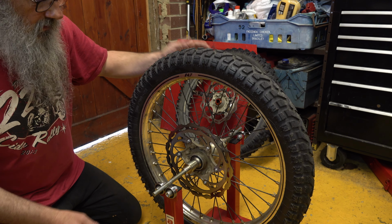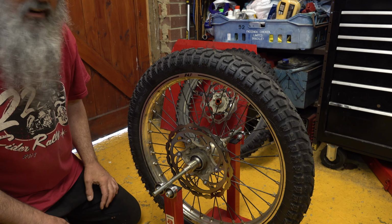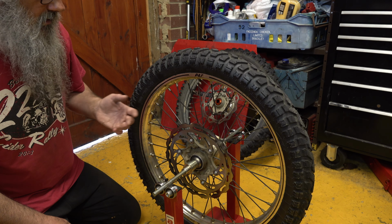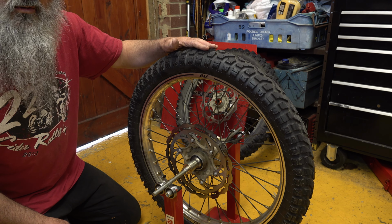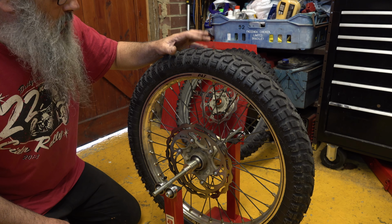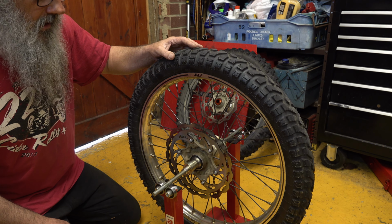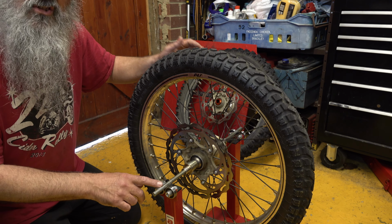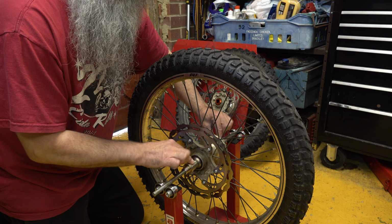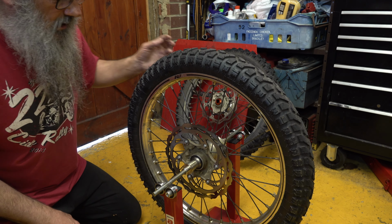Now, this is an Abba wheel balancer. It's a static wheel balancer. There's a lot of discussion about whether you should use dynamic or static balancing, but as this is used for GP bikes that do much faster speeds than I'm ever going to do on my KTM, I think it's good enough for me. So the idea is this: it's got extremely good bearings on here, and you've got a spindle that's got a sort of graded system, so you can fit it snugly